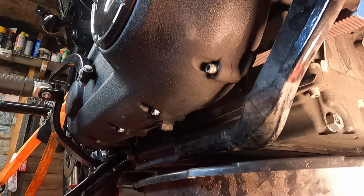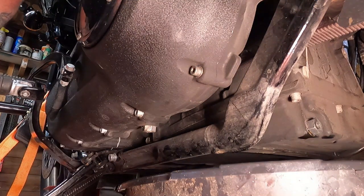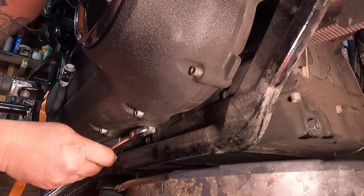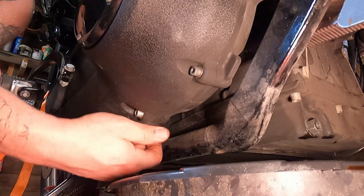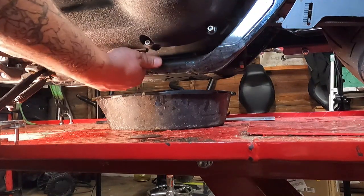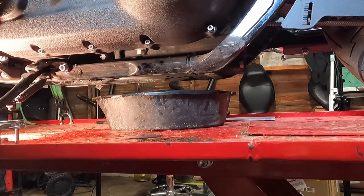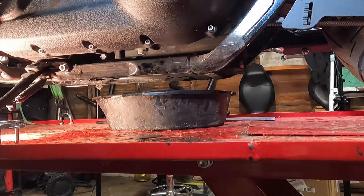Next, remove the primary oil. The primary oil drain plug is located on the bottom of the primary. This is a big hex bolt — takes a 5/8 wrench. Lefty-loosey that sucker out of there, and of course have a drain pan ready, because oil is coming out as soon as you pull the drain plug. When reinstalling the drain plug, start it in with your fingers all the way — if it's tight too early it's not fully threaded and you may be cross-threading it, which will strip it out. Snug it up and torque it to spec.